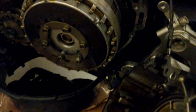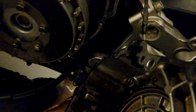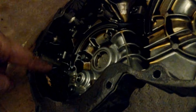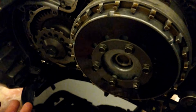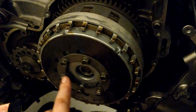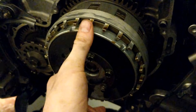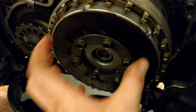There are a couple other quick things that are a pain to watch out for. I'm not sure what that wire is for — I was going to say it's a neutral safety switch, but I actually think it's a hall effect sensor for the engine, because it goes down underneath this little tray along here and then to this sensor right here, which just hangs out kind of right here. Other than that, this here's the clutch pack and basket. All you have to do is undo these bolts, this part pops off, and you pretty much take off all this.